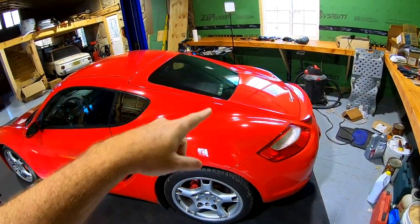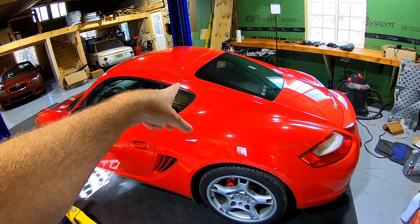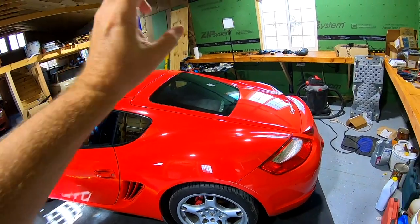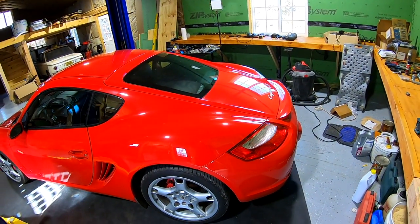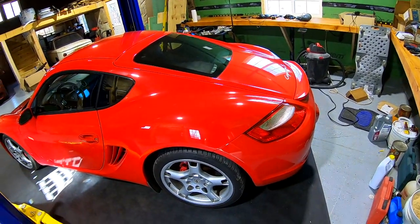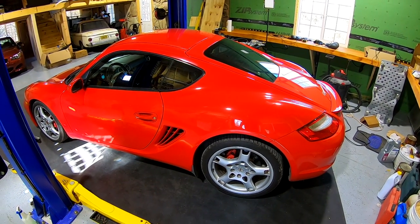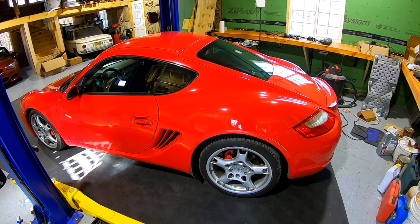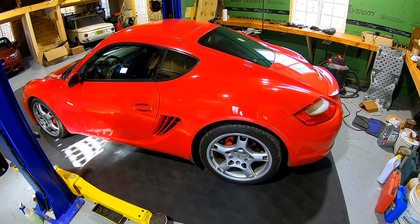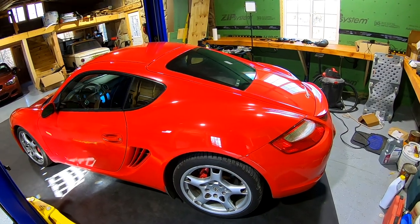On 987 cars, bank one is the passenger side if you're left-hand drive. If you're in the UK or Japan it's on the driver's side, but it's on the same physical side regardless. Here in the US it's on the passenger side. We're getting that error — it's rare but annoying — so we're going to fix it. We'll get up on the lift and drill it out.